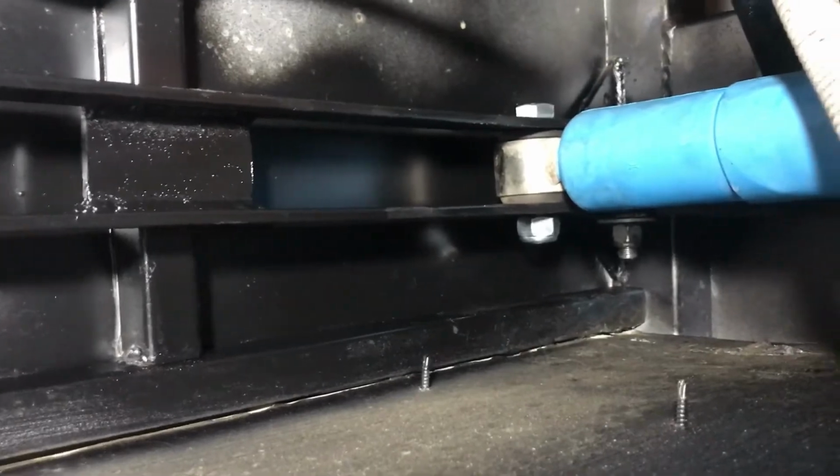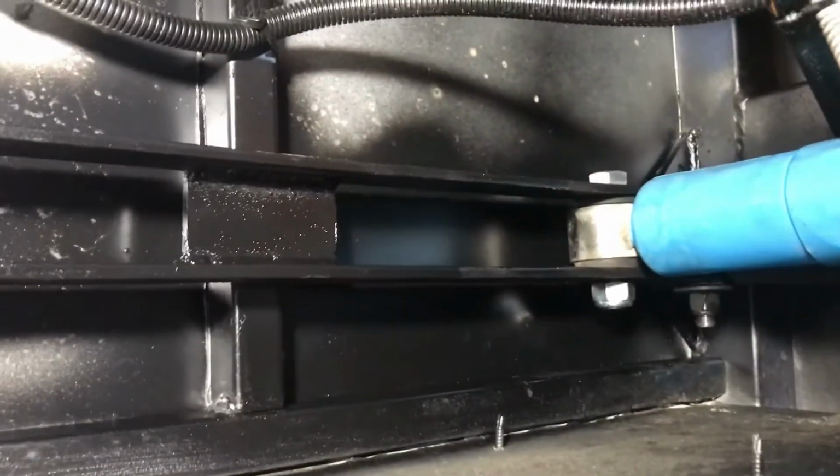So you can see the brace that I've made that actually bolts into the existing shock mount up there, and same at the other end, and then it's just got a new bolt location. I haven't drilled the bolt holes for these areas yet, but I will get to that. Just going to put a 10 mil bolt in there and one in there as well. I don't think it really needs it, but I'll put it in just for good measure. And yeah,